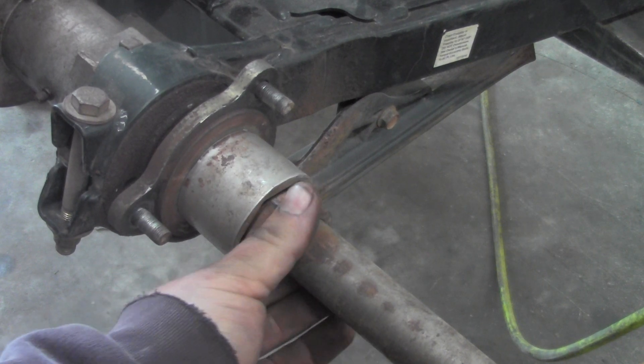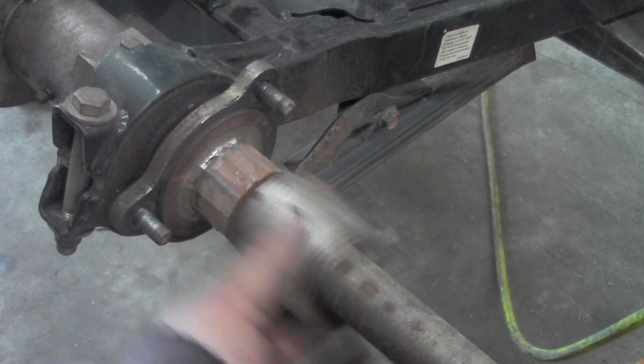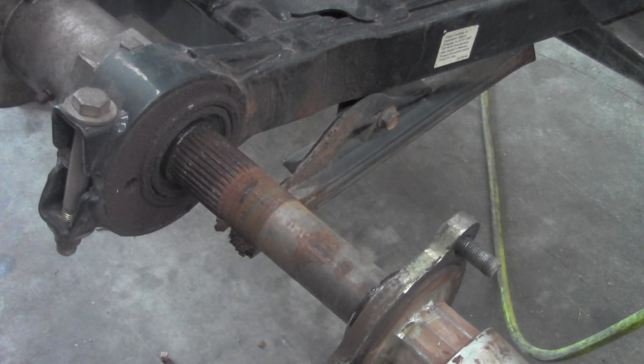Which at that time would look like that. This would also be under that collar. Pop that collar off, get that nut off of the splines or the threads. The sprocket mount is on a spline and will pop off.